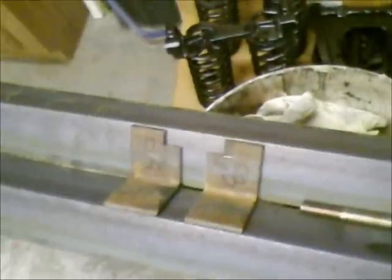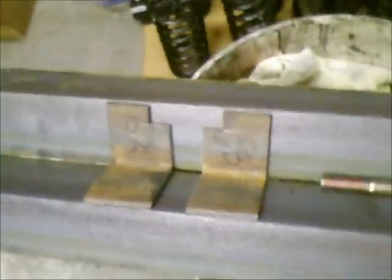I had to go buy some 3 inch by 3 inch, quarter inch angle iron, so it's going to be pretty hefty. It should handle up to 16 gauge or maybe even a little bit bigger sheet metal. If I'm able to physically move it, I'm sure the brake will probably handle it. The plans were pretty detailed, and I've been working the last couple of days machining all the parts out.